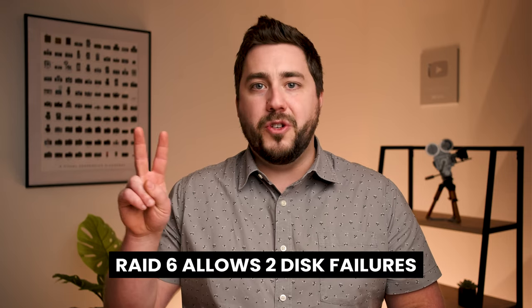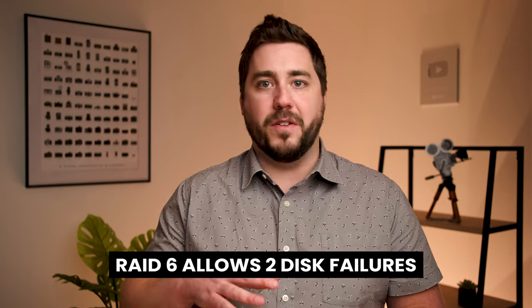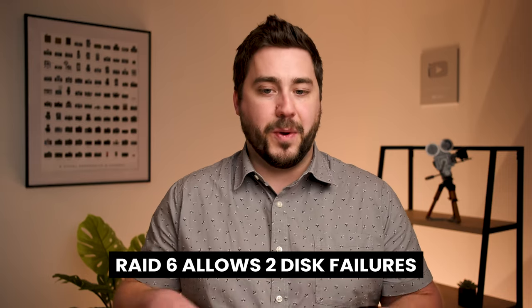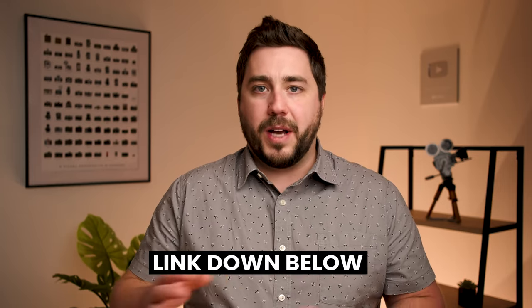You could also go with RAID 6. RAID 6 would provide you 2 disk failures. However, you're going to go down to 8 terabytes of usable capacity with a 16 terabyte total setup. So you can configure this however you want. I will point out, I'm leaving a link in the description to the RAID calculator that will show you how much storage each RAID arrangement will give you and how all of that works.